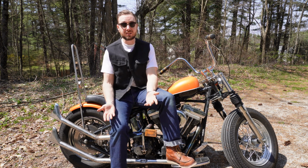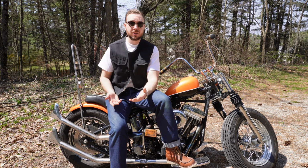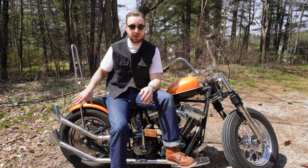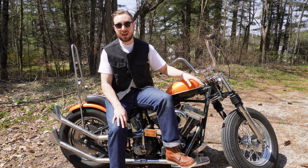So in the beginning of the season, even if it's the only time you do it, check the tire pressure on your front and rear. And yes, us hardtail guys do tend to run, I run about 10 PSI less in my rear tire than I do in my front tire. I can't give you the exact tire pressure because it's based on the tires you're running.